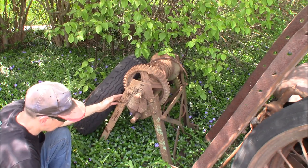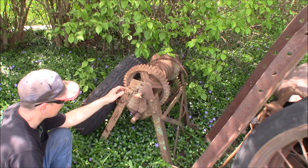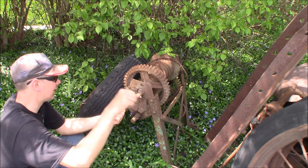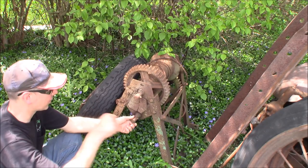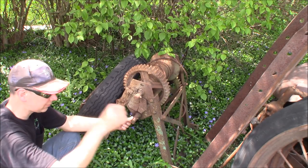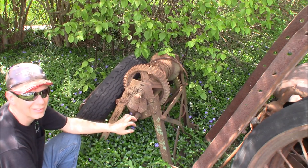What you get is your angle iron tripod with feet, and you would buy this unit and put it in the back of your tow truck back in the day. There are two sets of drives — I don't have the hand crank for it, but it would pin on here over these two stakes. You could either drive it single drive off the top spool, or there's a gear reduction and a locking mechanism on the other side. It spools the cable out over the arm or chain, and you would let it down and use your block and tackle to pick up cars — vintage tow truck action before they had hydraulics and automated electric winches.